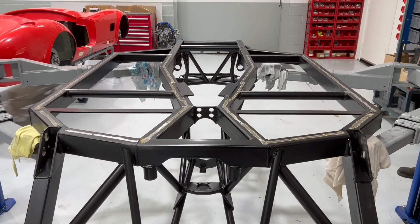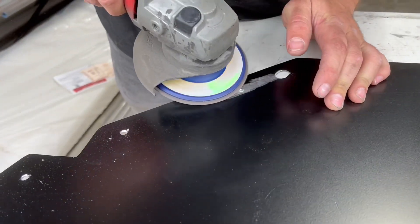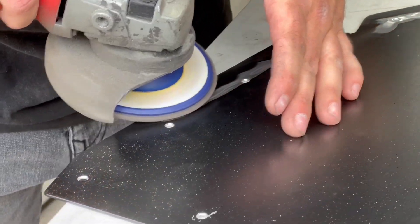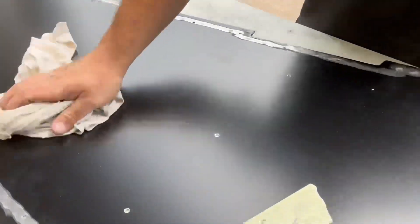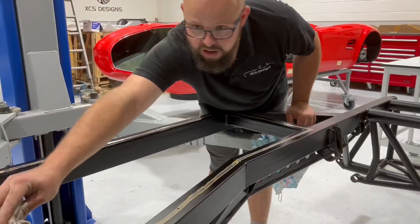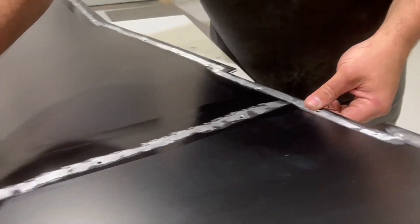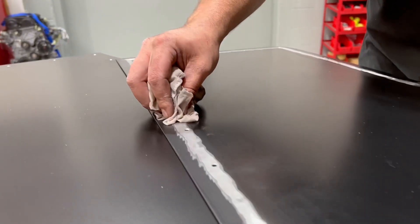That's what you should be looking at before you start. It's worth marking up each floor to make sure you get the right side — don't do both sides of the same floor pan. Once you've done all of that, give it a good wipe down with a dry, clean cloth, then on to panel wipe. Really take your time here — you don't want anything left on there that might contaminate the sealant or the seal that you're about to make.